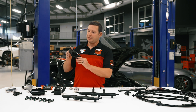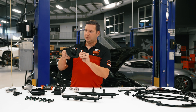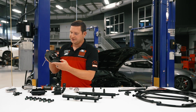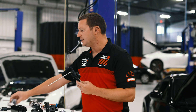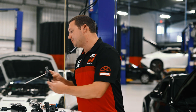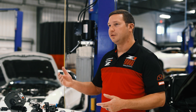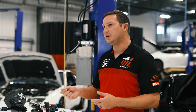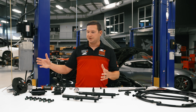If you're optioning to add our fuel billet pump hat, you can be sure you're not going to have these snap away like the factory one, which is very common. We include this and all the fittings and pieces needed. It's a really nice robust piece, works with the factory O-ring, and has nice counterbored pocketed hardware spots. It's a good looking piece and you can trust your pump's going to stay in place. Those kits come complete with terminals and connectors you need to repin your upgrade. Depending on the pump you choose, you may need to add an auxiliary relay to support higher current flow, so it can be somewhat custom depending on your management method.